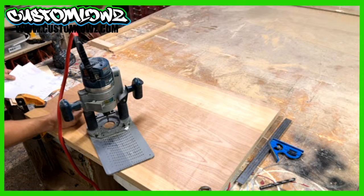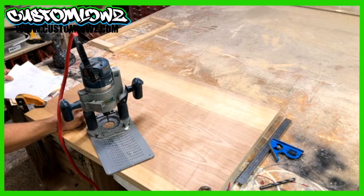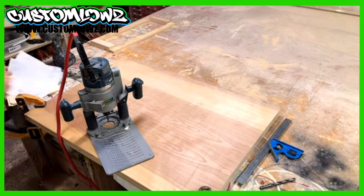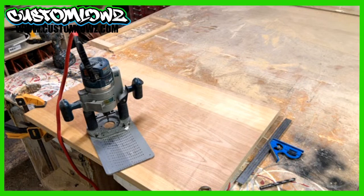All right, so our inner dimension is 7.5 and our OD is 8.65, which is a little bit bigger than 5/8, so we're gonna make it 8 3/4, just so we know the subs are for sure gonna fit in there. A lot of times the sub manufacturers, they're a little off on their outside diameters because of the gaskets for whatever reason. I don't know if they just can't measure them right or they just choose not to, I guess.